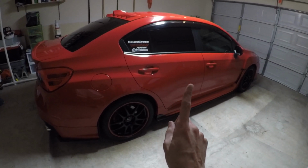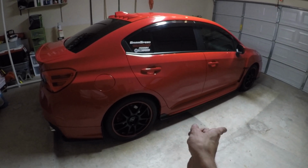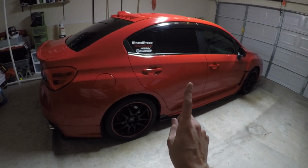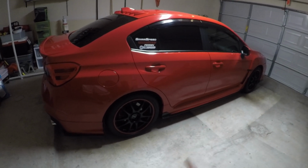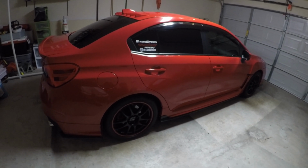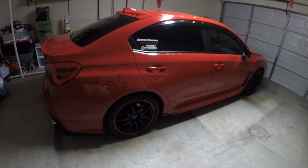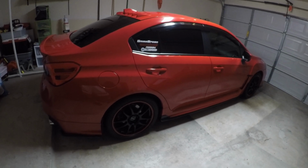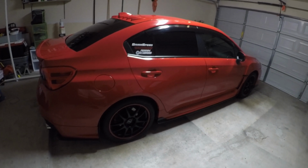here, you're going up, boosting in second. As soon as you go into third, you drop, and then it picks up and kind of bounces and then goes again. What's actually happening now is it's going out and then shifting into third, it's coming back a little bit and then continuing to go again. So it looks as if it circulates a little bit better and doesn't release as much air out of it, which is pretty understandable after looking at and hearing the difference in blowing in one versus the other. You could hear air escaping through the OEM one.